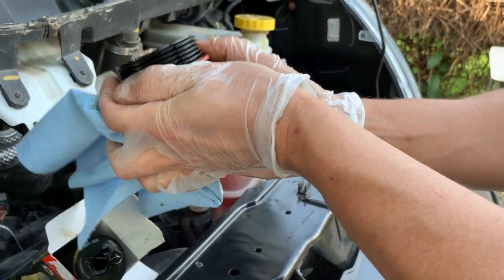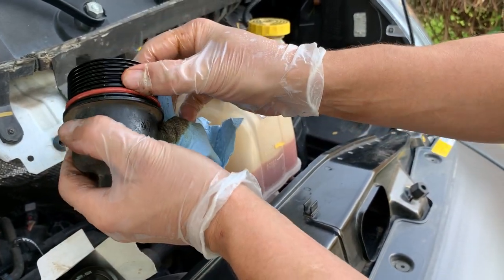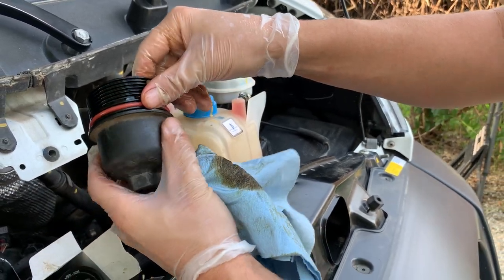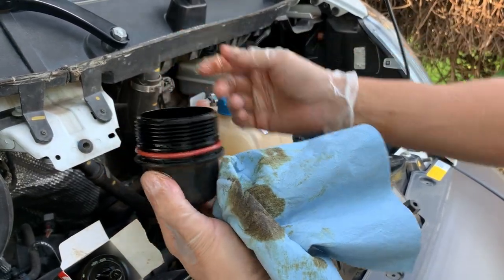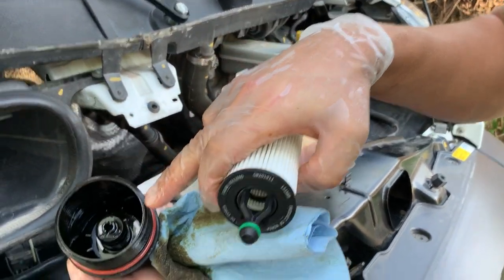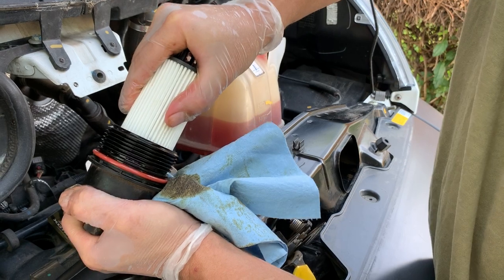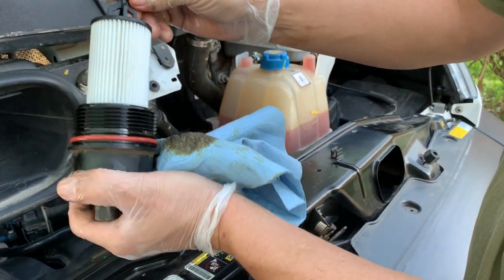Once we get it on we're just going to roll it down into place. There's a little lip that sets up and it should be about the same level all the way around. We're going to make sure we coat that with just a little bit of oil so it seals when it sets back in there — I've already got oil on my thumb and that will be good enough. Then we'll grab the new filter, place it right on that seat inside the cap, give it a push, and it makes a little satisfying snap so you know it's in place and it's not going to fall out. Then it's ready to put back in.